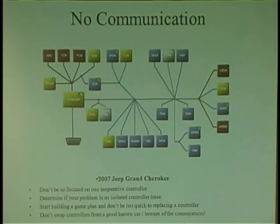But meanwhile, you didn't go and check other ones. You go, oh, look, the ABS won't talk either. Could be the ABS computer or wiring. Oh, wow, the TCM won't talk either. How are 3 computers going to be bad? So you see how this helps out by going a little further with your tool and checking other modules, because that's the way you have to do it now. You have no choice. This makes your job easier.